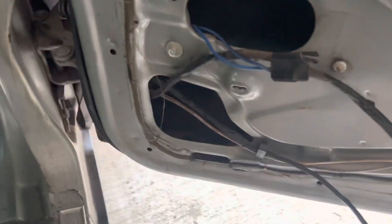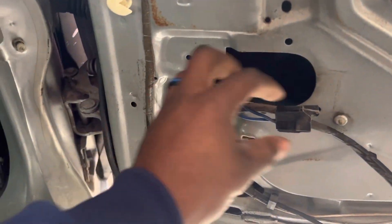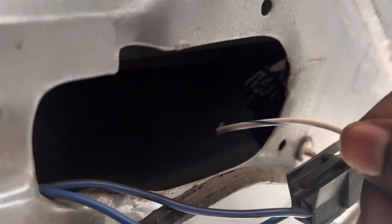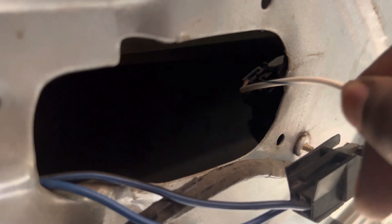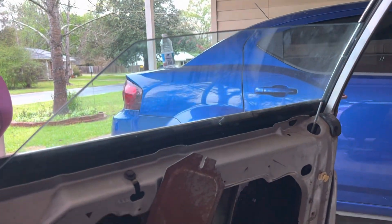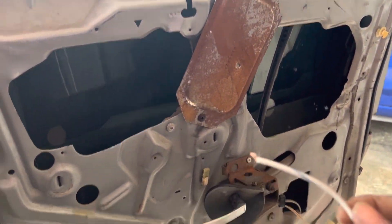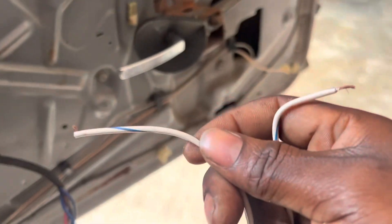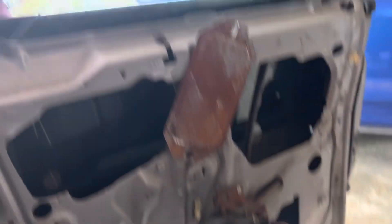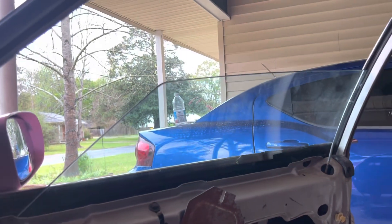If you can get your hand in here — y'all can't really see but I got my motor right there. Your window motor is gonna have two wires on it. I took the wires off; there's a terminal here and a terminal there. You're just gonna touch those terminals and it's gonna move. If you twist the wire to the other side — I'm not sure which side is negative or positive — but vice versa, it'll go up and go down. That's how y'all do it.